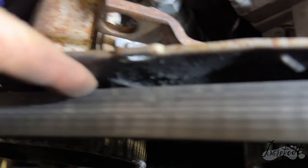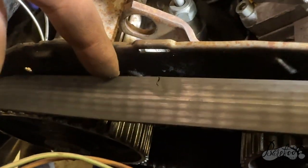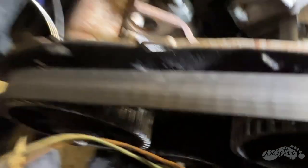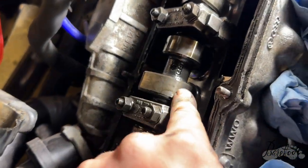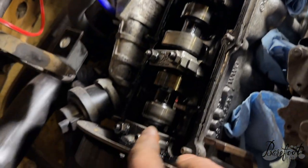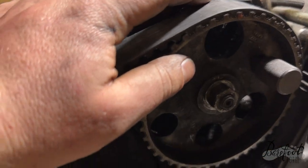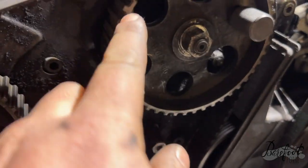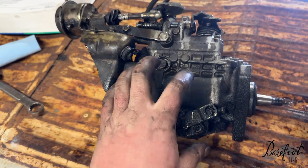Talk about a ticking time bomb - look at the crack in that timing belt. That is absolutely going to fail. Luckily we're replacing it. Got the cam cover and valve cover off - these cams look to be in really nice shape, no significant wear, everything looks good. This gasket is rock solid. Setting the timing alignment - this piece of red aligns with that small piece of red, relatively. Taking the injection pump off - sometimes it's recreational. Looks like it was leaking from down here and probably this main seal.